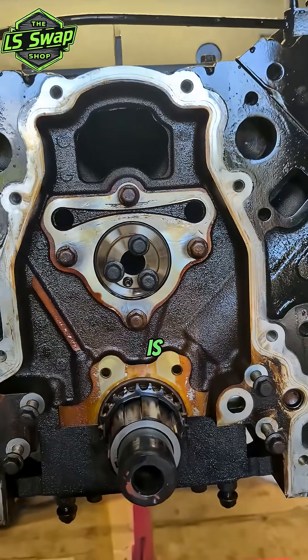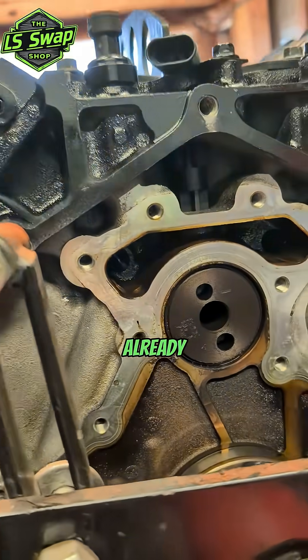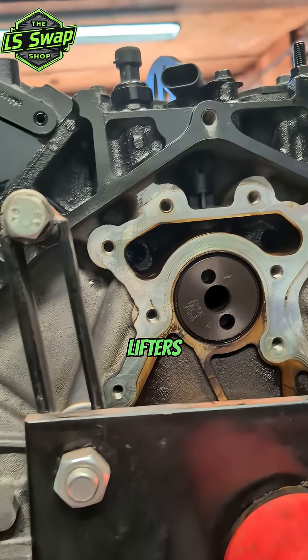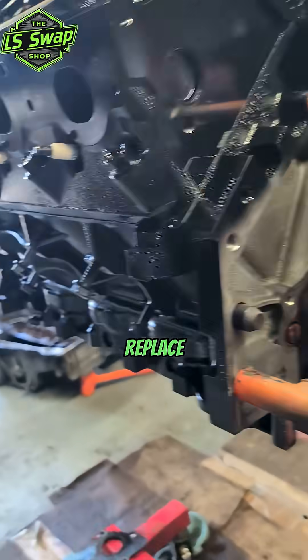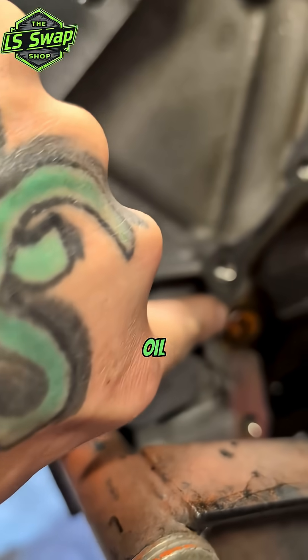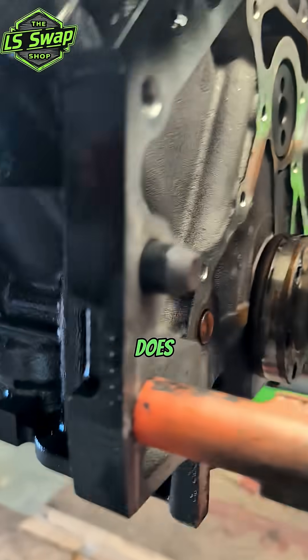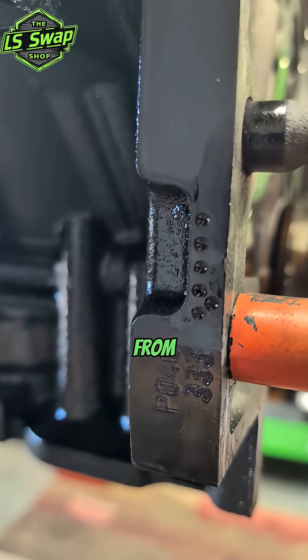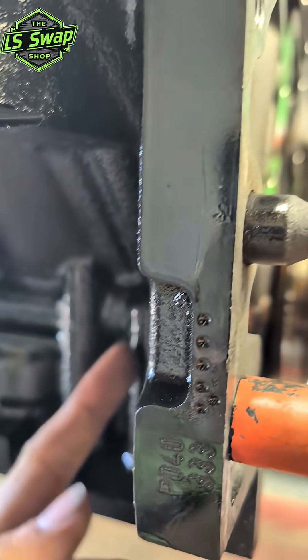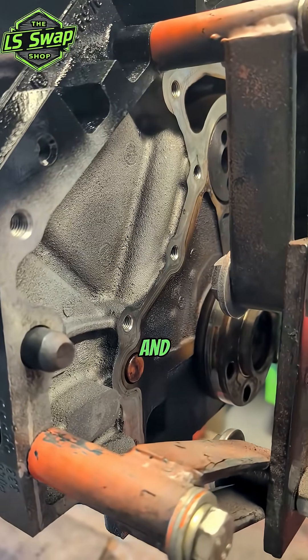One more thing I want to talk about is on the back side. Now that we're at the back of the engine, I got the rear cover off already. You can see straight through the oil galleys for your lifters. One thing you want to replace every time you get a junkyard engine is this — this is the oil diverter, otherwise known as the oil galley barbell. What that does is divert the oil coming from your oil pump, sends it down into the oil filter, and then back up into your lifter area, so you can get to your cams and your crank.